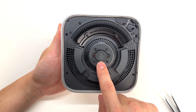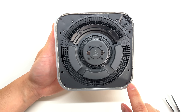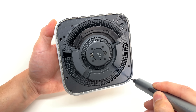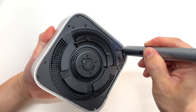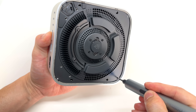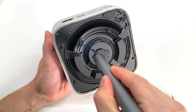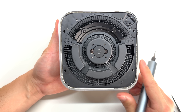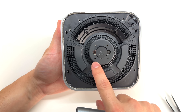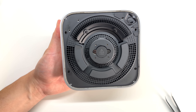We also have what looks like a button battery here. Let's go ahead and remove these Torx screws and see if we can remove this back cover. On the perimeter of the Mac Mini we have a bunch of T5 Torx screws, as well as four in the center. The heat sink uses T3 screws.